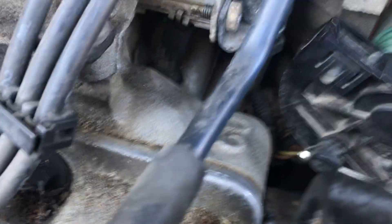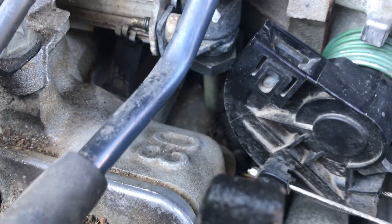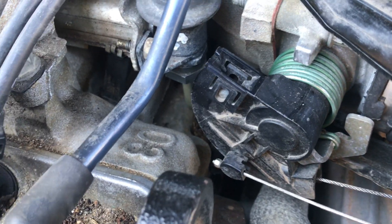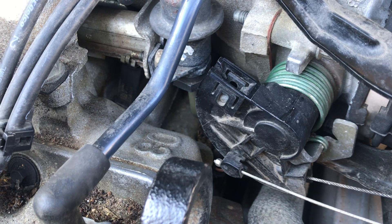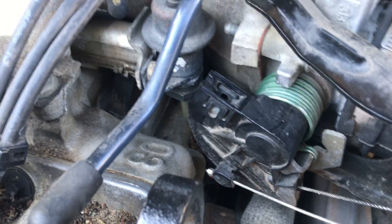The main nut below it — you've got a fuel line right there, if you can see it. That's a 24 millimeter. Try to find yourself a thin-wall wrench if you can. I had a regular gas line type wrench for 24 millimeter, so it kind of worked, but it was a headache.